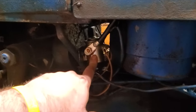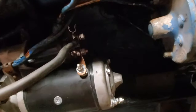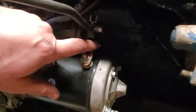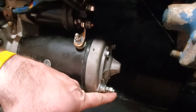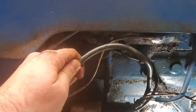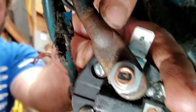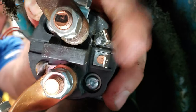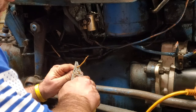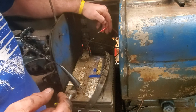Since this solenoid is right here, we can just bypass the old one — I won't need that anymore. I'll have to make my push button wires a little longer so they can land on this solenoid back here. I'm going to have my battery power coming from here; once the solenoid clicks over it should have power to turn the starter over. I've rerouted the battery cable from the positive on the battery right here to the solenoid. I need to figure out which terminal to hook to, cut these ring terminals off, and put some butt connectors there. I need a hot to go to that switch, run through that switch, and then go to the starter solenoid.